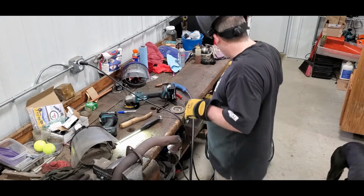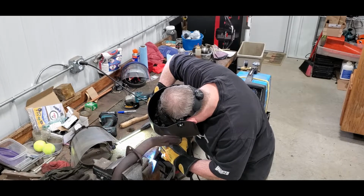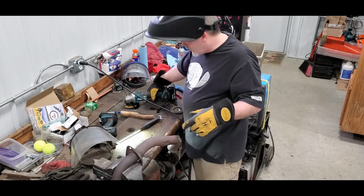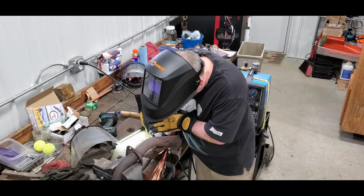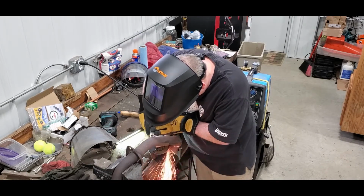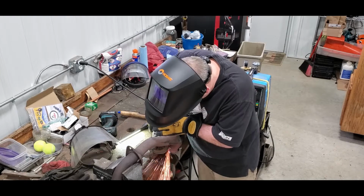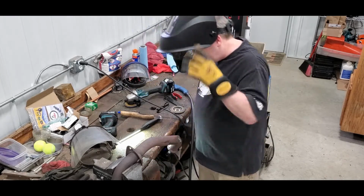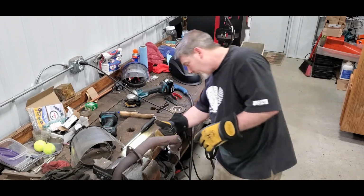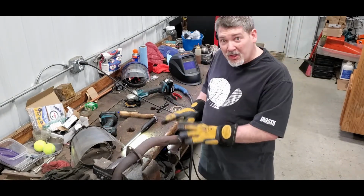We're down to one tiny pinhole. So, that should have been it. There, I think that's going to seal up pretty good. So I've just got to pull it, clean this lip, you know, where the donut seals to the manifold, and we'll call this good enough.